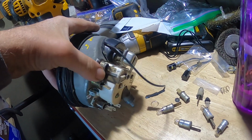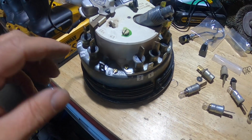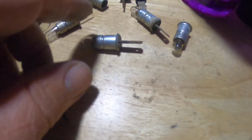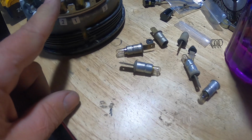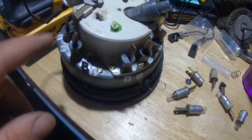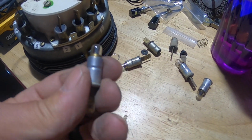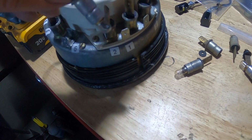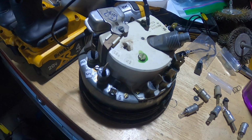And just wanted to show some of you youngsters that are starting to work on the Volkswagens. The indicator lights, if you have some burned out bulbs, they have these little sockets that plug in to each section. Like this is probably the alternator, that's oil pressure, this is your four-way flashers, and so on. And these little bulbs, just push them in, twist them, and then they pop out, and then the socket will accept the new light bulb assembly to go back in. So that's all there is to it, but it is a bear to get to up underneath the dash.